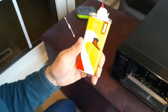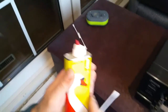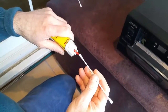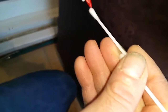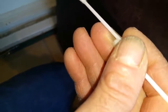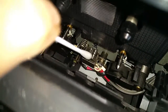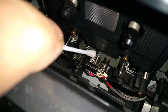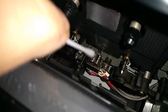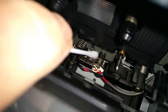Now we've cleaned the pinch rollers and we're going to be cleaning the heads with lighter fluid — it's a chemical-based one. We get some and pour it onto the end of the cotton bud. Right, we've got some on the end there. We want to give these heads a really good scrub. I use lighter fluid because it evaporates extremely quickly and it doesn't melt anything. An electronics engineer told me to do this and I've been doing it ever since — it works extremely well.